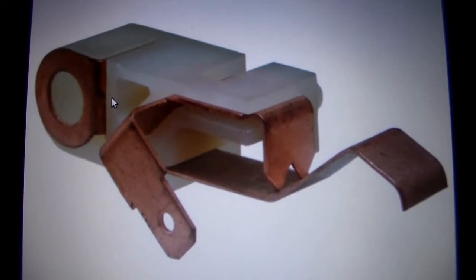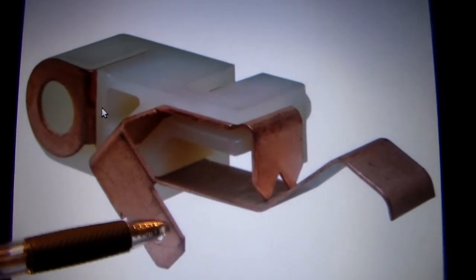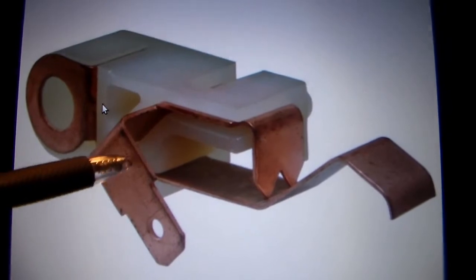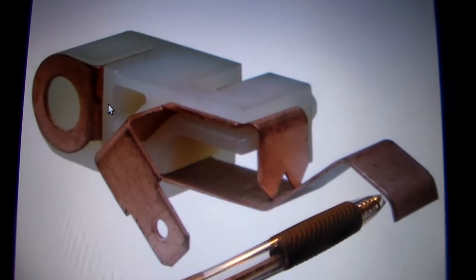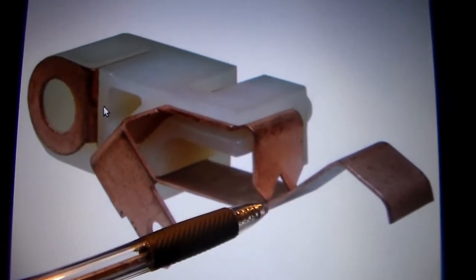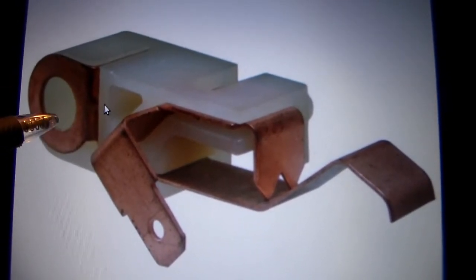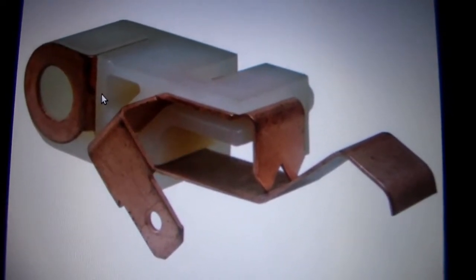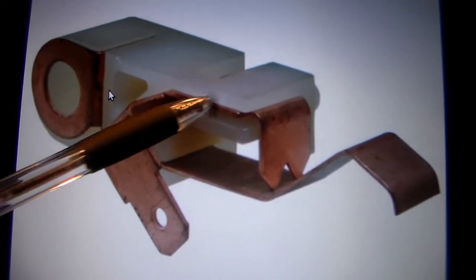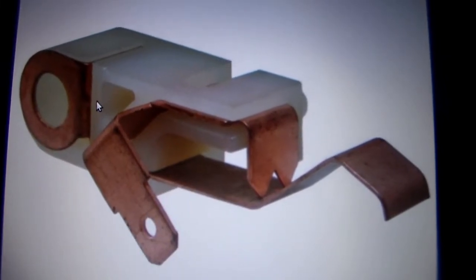This is the parking brake switch — let me explain how it works. We have a wire coming in from the car's computer that connects here, and this connection goes all the way around to this contact point. We have a second half of the switch that starts with this lever, has a contact point here, and ends where it bolts to the body of the car — this is a ground. So when the parking brake is on, this wire from the computer connects to ground, and the computer knows by that that the parking brake is on and turns the dashboard light on.